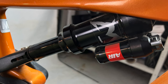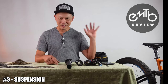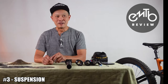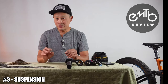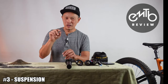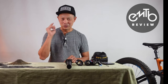That same bike had a 140mm fork and I upgraded it to 160mm — boom, new bike. Make sure you watch your geometry, but it really allows you to use the e-bike for more adventures and more fun. The key with the fork upgrade is the Fox Grip 2 damper — now you have four knobs of damping adjustment. Be a student of adjustability, learn to adjust damping settings and air pressures, because it pays dividends. Tire pressures too.